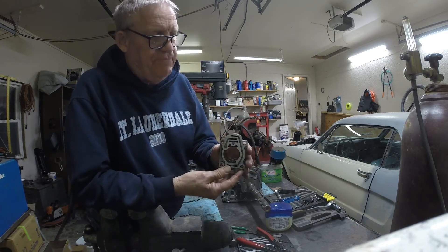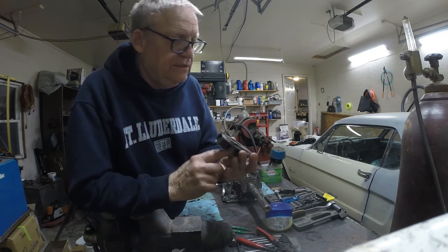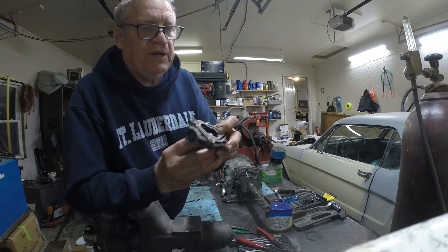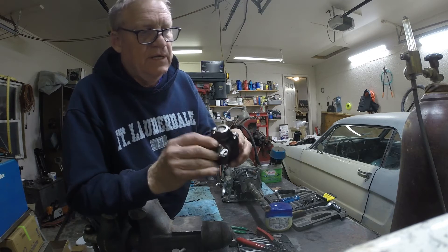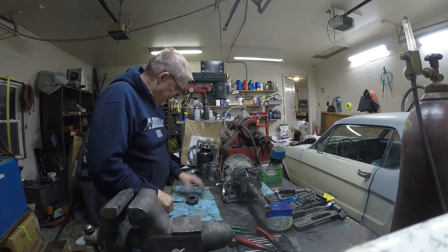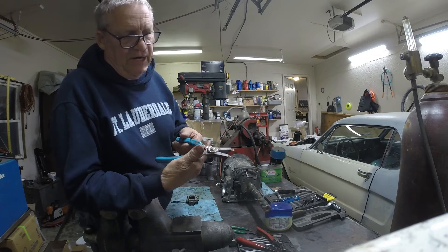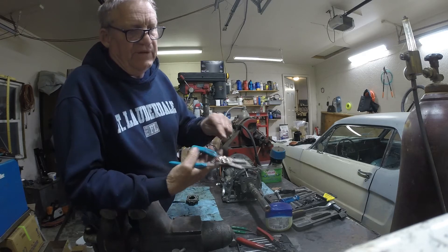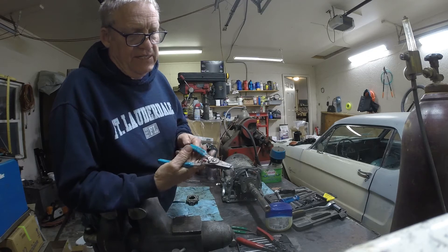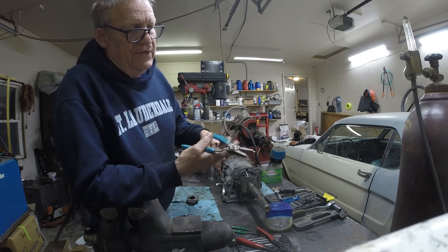Here's the governor — it has two sides, the major side and the minor side. On the minor side, you take a screwdriver and push that spring back while you push that part up. Over here it has a clip that you take out with your snap ring pliers. There's a slightly different kind of snap ring pliers — you can flip it over, give it a click, and now it does outside; flip that lever back and now it does inside.